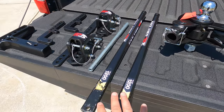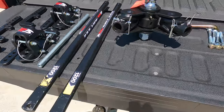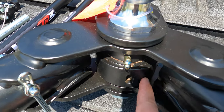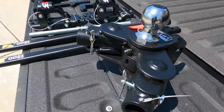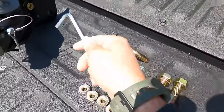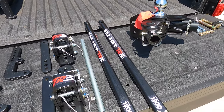It's a good looking hitch and it is different from other hitches we have tested. It looks very similar because you've got the bars and you've got the hitch head, but these bars aren't going to control sway. What actually helps control sway in this situation is brake pad material inside this hitch head assembly, and you tighten that down. If you need to take off your sway control — if you're on ice or something like that — you can do that. But if you need to turn it on, you take this Allen wrench and zip that down to upwards of 300 foot pounds of sway control.